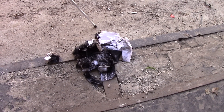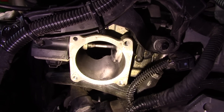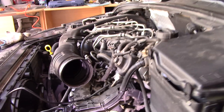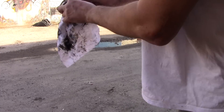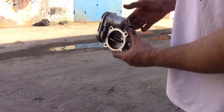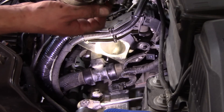After a while, this is the amount of rags we've used — and the EGR valve is now pretty clean. You can do it without removing it from the car. Moving on to the throttle body — pretty much the same idea, but this one you can spray directly. A few more rags to get a clean result — all done, clean throttle body.